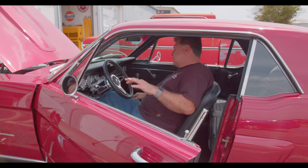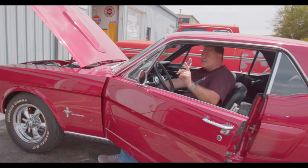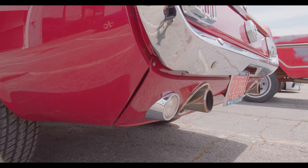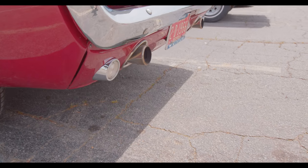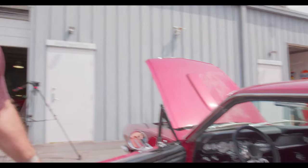Let's play some music for you — are y'all ready? 3, 2, 1. Bam! And that's cold. Listen to that thing. She's got a little bit of an exhaust leak — if you come close, you can hear it tick. By the way, when you fire a cold motor, give it about five minutes — get some heat in the motor. Don't sit there gunning it. That's how you quickly damage a motor.